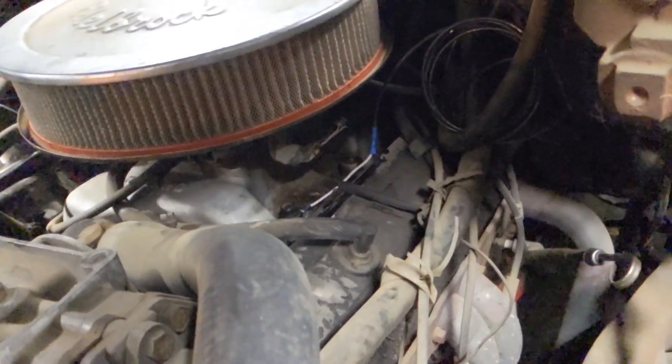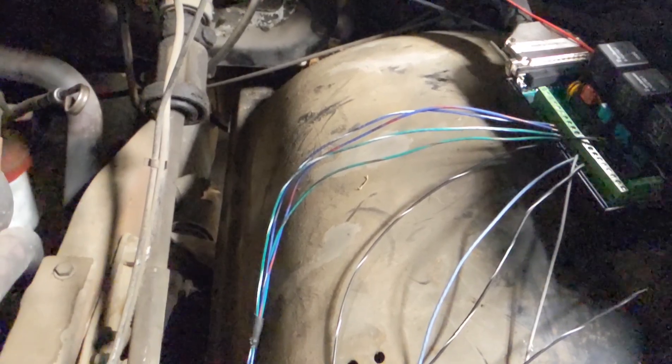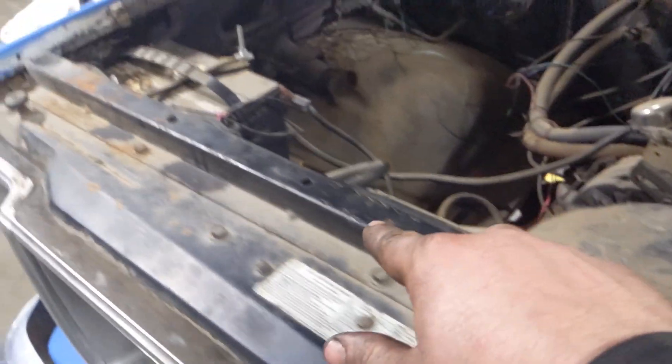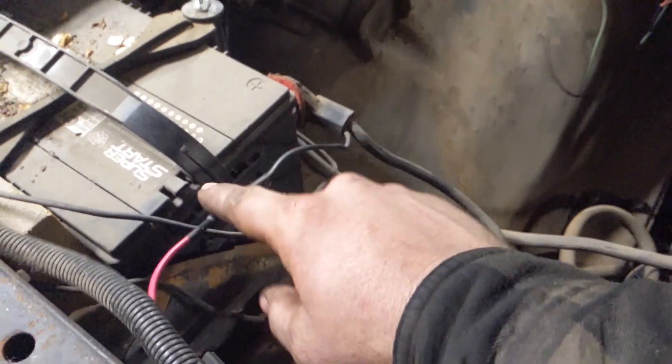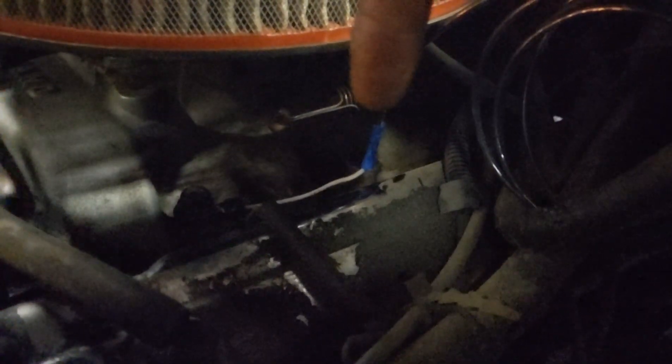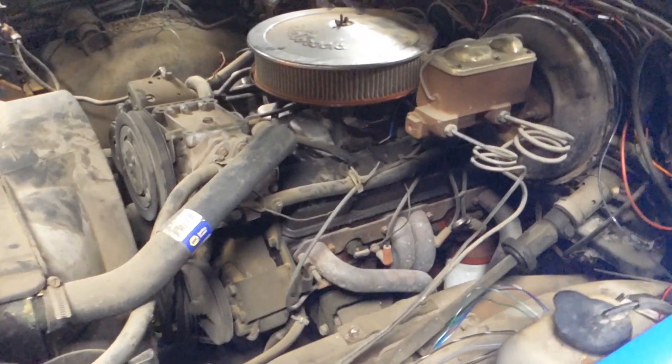I will replace the CLT and the IAT just because I'm not sure I want to trust the ones from 92, but those are less critical so it's whatever. I routed the power wire into the existing harness that comes all the way around. The auxiliary power input — I'm told this is for a block heater, but since we're not using that it makes an excellent power source for the Megasquirt. The ground wire is temporarily screwed to the intake manifold. Obviously a 12 gauge wire going down to an 18 gauge wire is not ideal, but I can't find any ring connectors that fit this big wire so I can bolt it to the back of the head — that's coming, I need to hit up a parts store.